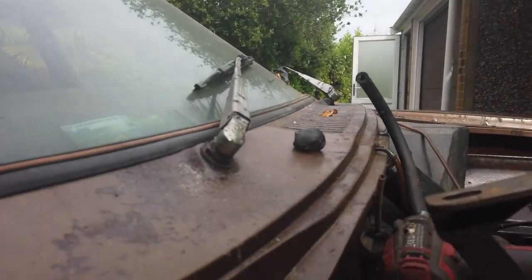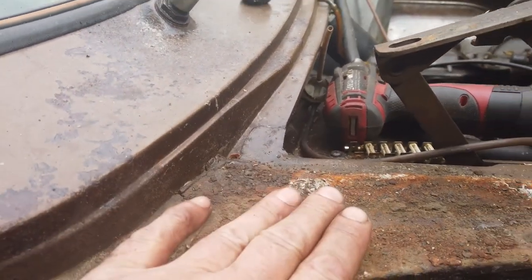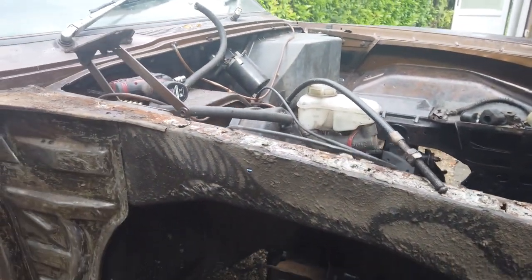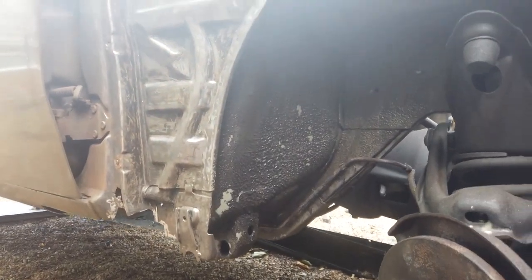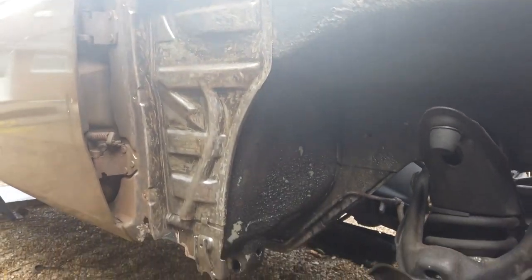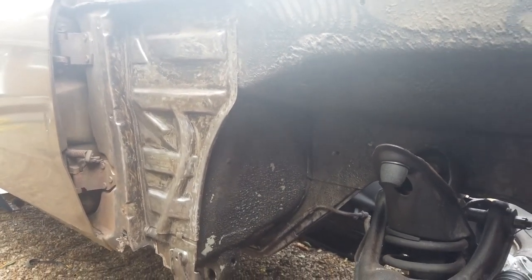A piece will slot into that, then it's a vertical piece down with a curve on it for the bottom of the A-pillar shape, then another piece here curving and meeting it with a right-angle lip on it, then stitch it all together. That hole will be treated separately. Look at the mint condition of the rest of it though - even your troublesome tops of the wings haven't even rotted. So this is good - all that's solid. Wing off of course, so yeah, we're good to go there.